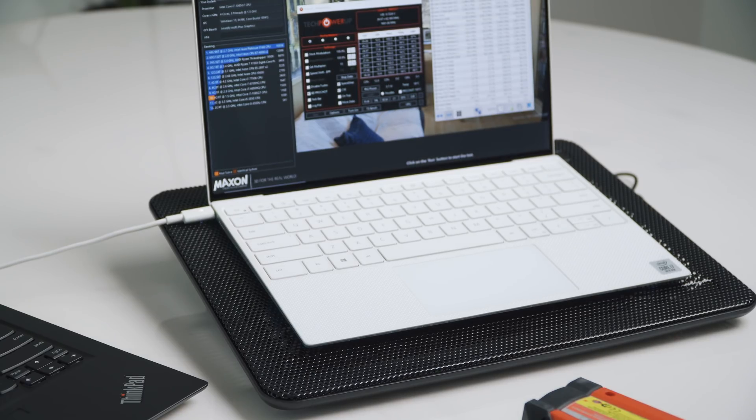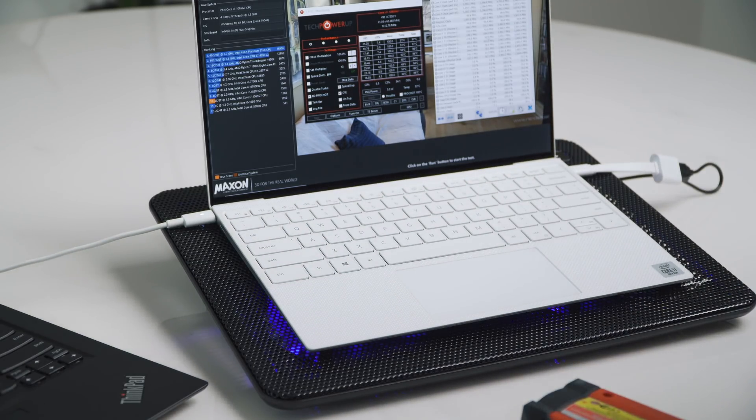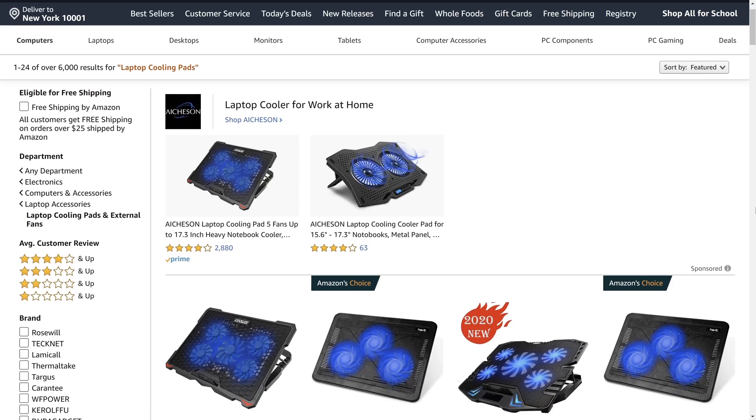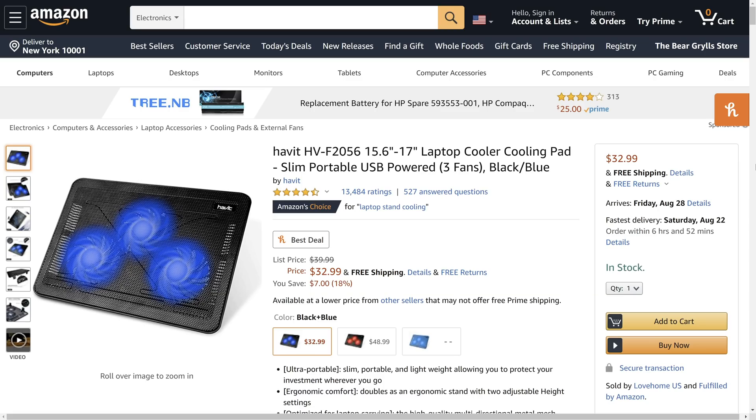Laptop risers and cooling pads. If your laptop is still too warm, you could purchase a laptop riser or a cooling pad. These lift the laptop up for better airflow. Cooling pads usually have fans powered via USB that provide additional airflow on top of your laptop's own fans. Although these can work very well, both tend to result in a little more noise — the riser because the laptop fans are louder when lifted, and the cooling pad because of its additional fans. In the case of the Dell XPS 9300, the laptop performs substantially better with the cooling pad. I'll post a link to the one I bought in the description below.